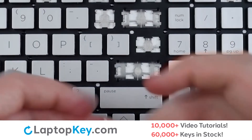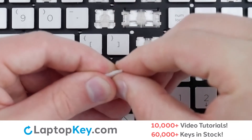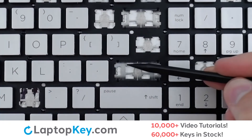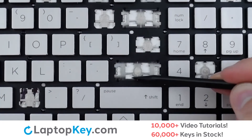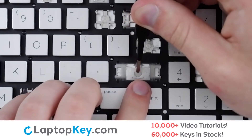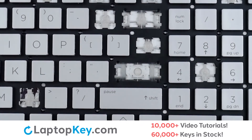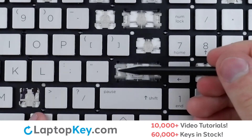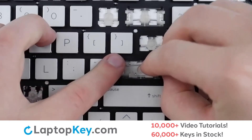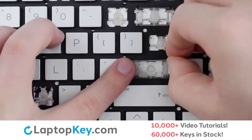Similarly to the standard size keys, we will connect the two halves together by inserting the top half through the bottom, connecting in the middle, pushing downward slightly. Then using the metal hooks, we will lay the clip down bottom first, support at the bottom, small press on either corner. We will then put the metal support arm back in place using the top set of holes by inserting one end, pushing all the way over, inserting the other end, and laying down flat.